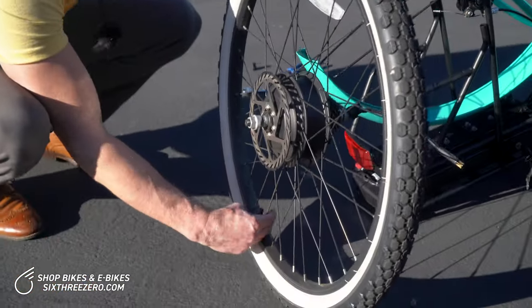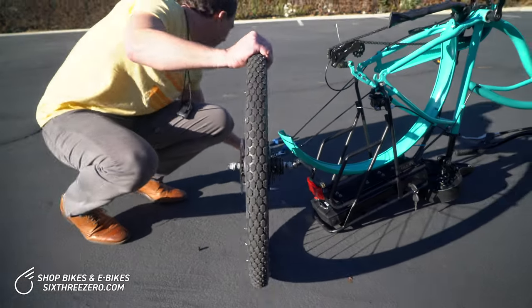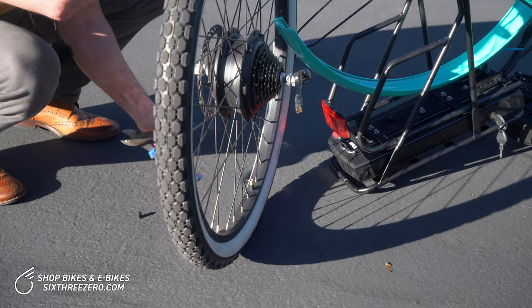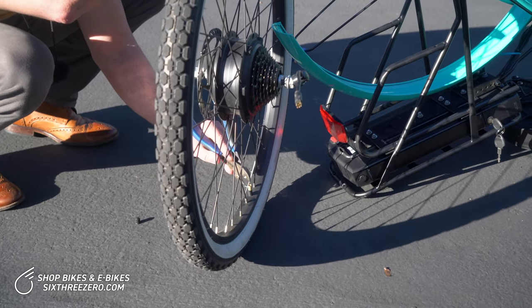This one's full of air because it's not actually flat, so I'm going to let the air out so we can take the tire off. You can do that by pressing on the valve stem with anything — a ballpoint pen, something pokey. Just going to let the air out.